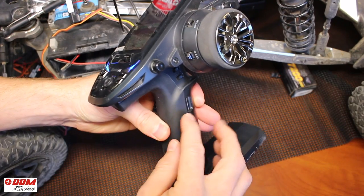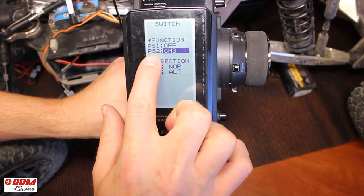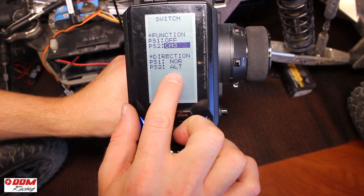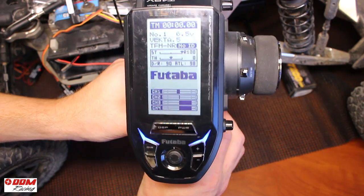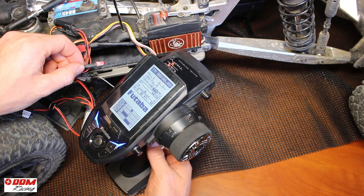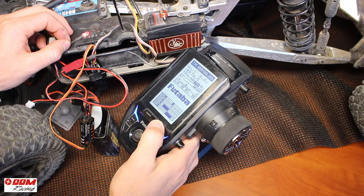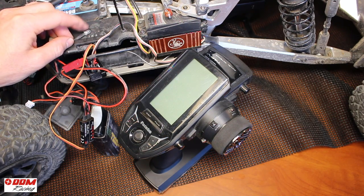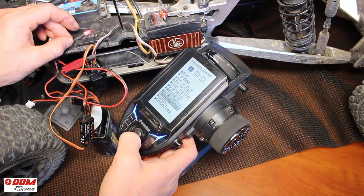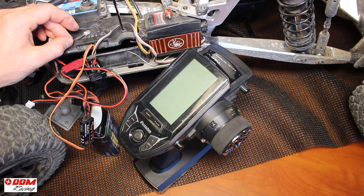Now adjust the radio to the kill switch. For the Futaba radio, I'm going to use push button switch number two to function channel three — that's something that can be programmed on your radio. This is the Futaba 4PV, and on channel three it swings in full direction one way or the other. The status light on the kill switch will show if it's activated or deactivated — red means you can fire it up, light off means it'll kill the engine. Make sure you set your fail-safe point so that on channel three, if it loses radio connection, it also kills the engine. You can see the servo for the throttle brake goes to full brake and it also kills the ignition. If it's not doing that, read the manual and set that up correctly.